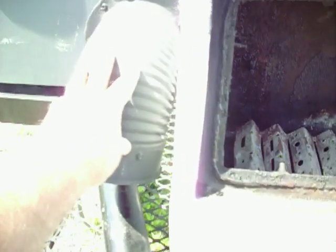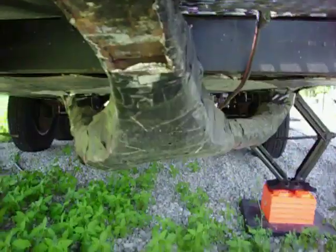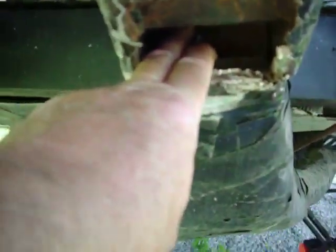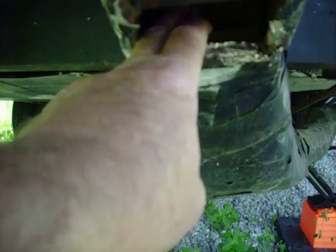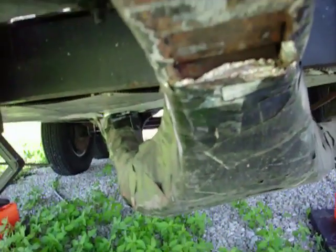So what happens is the 12-volt blower blows air through the plenum, goes around, and is put into the ductwork system of the fifth wheel. Now, depending on how hot it is, if it's in the summertime and you're just using this as a cooker, you trip the lever right here, and it blows the air outside the fifth wheel. You can also use this to adjust how much air you get into the fifth wheel. If you let it down, all the air goes into your fifth wheel.